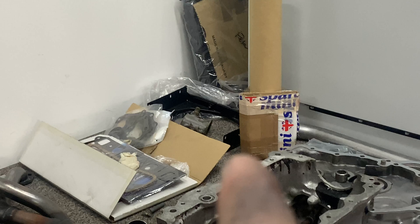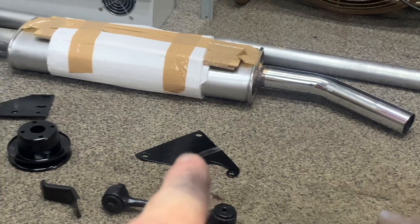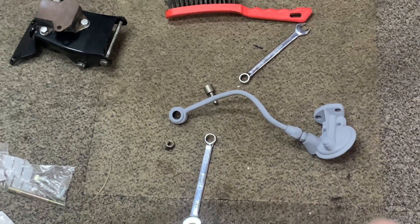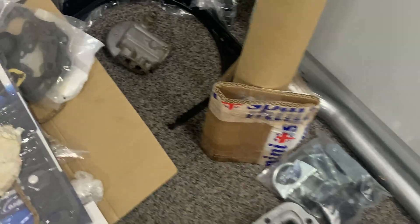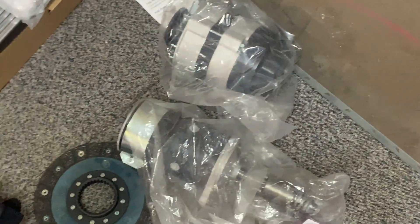We've got the little screws that go into the radiator surround, and we've also got the radiator that goes into that little part, plus little washers and new nuts and stuff as well. I don't know whether I'm going to paint that black or silver yet. That's the spin-on oil filter — I've gone to spin-on from the old cartridge type. The old cartridge type's down there. Inlet manifold. Exhaust. Clutch that's all been done. New alternator and starter motor.